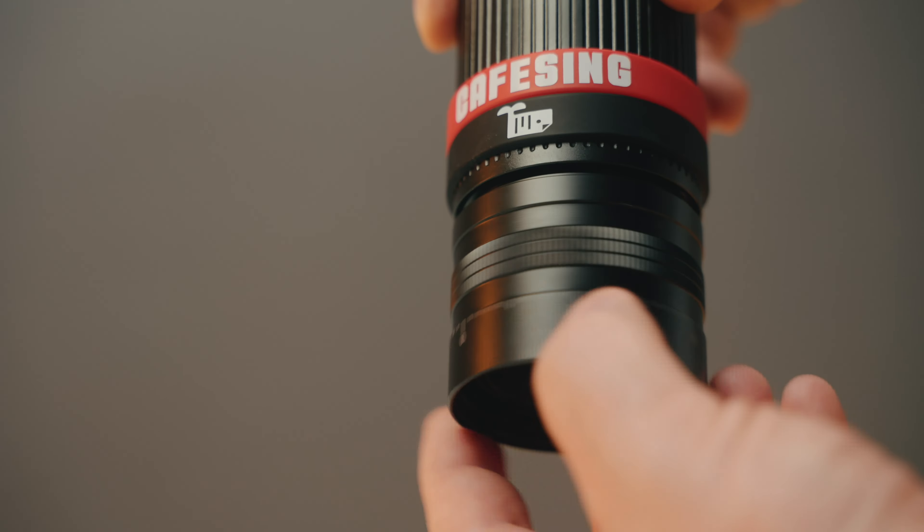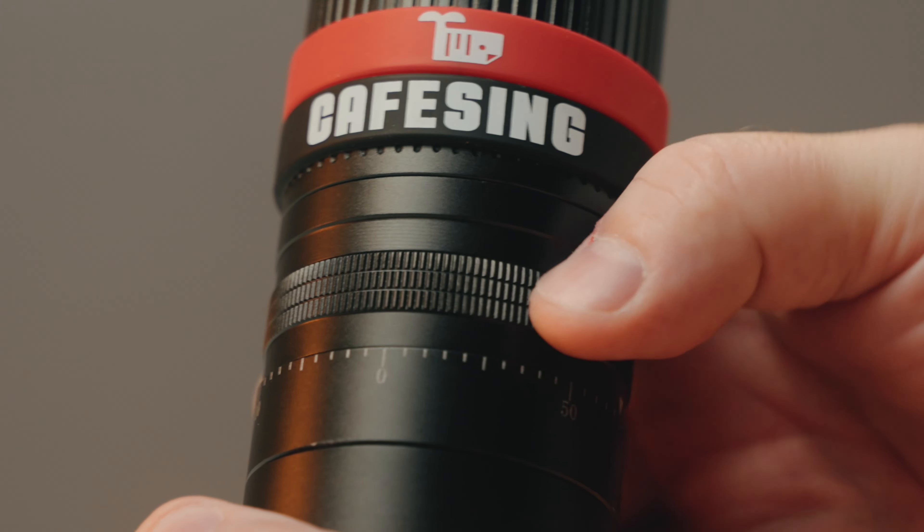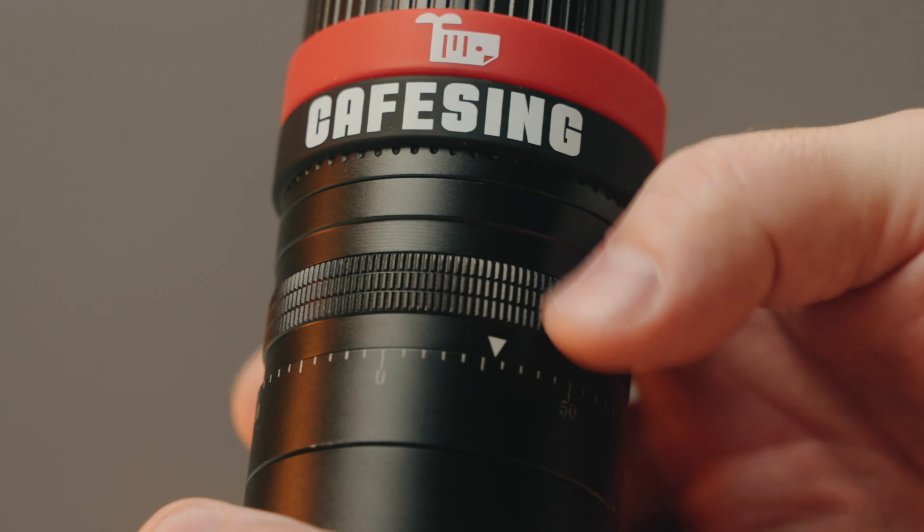It's literally that quick to take apart, which is really nice. To disassemble the rest of the housing where the external burr adjustment and stationary burr are housed, you simply rotate it clockwise — it's a reverse thread — and you can pull the whole grinder body apart. Each click is a 16 micron change in grind setting, and there are 120 total click positions, giving you good adjustability to dial in espresso and other brew methods.